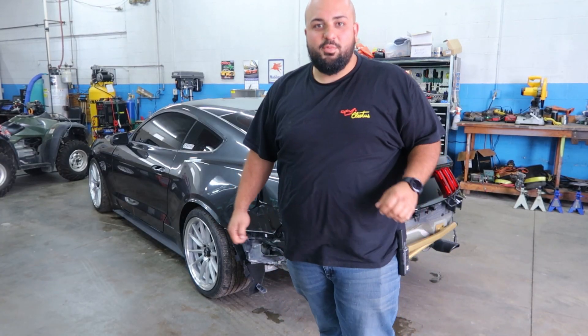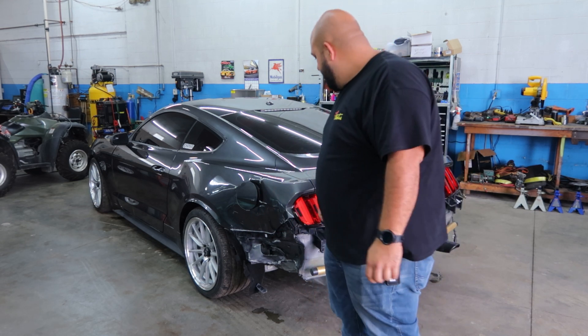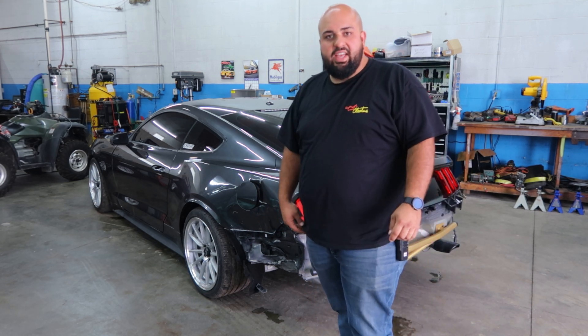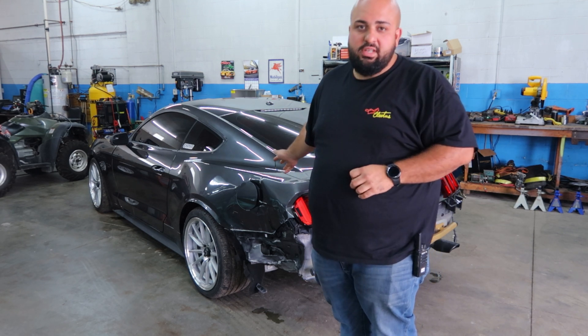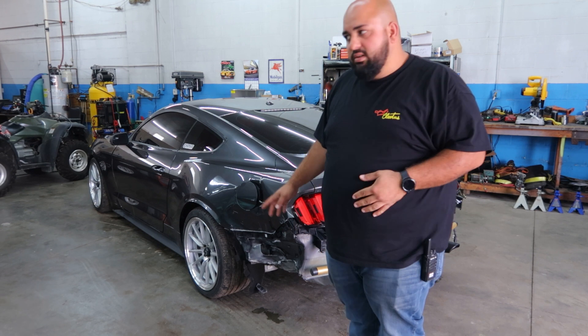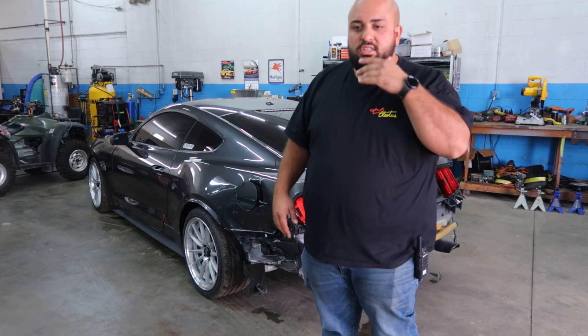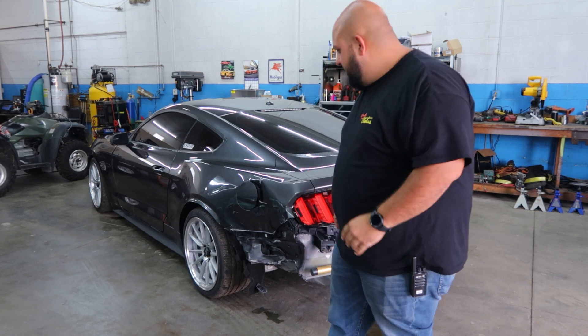What's going on YouTube, Tony here with Big Ugly's Garage. I'm going to be doing a little bit of body work in this video on the S550. I did get it running and rolling — it goes on the road super nice. It was all over the place, but it ended up being the alignment; the rear toe was out. So I told you if I wouldn't go to accelerate the car would pull on the road. But anyways, it's all good now.